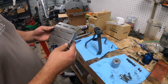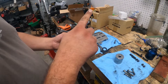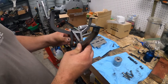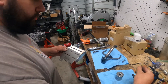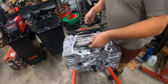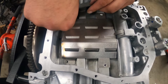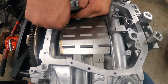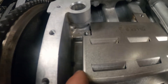If you're doing a stock rebuild this is going to look different. This is the Killer Bee baffle — it's pretty. This is their moneymaker, the pickup. We've already installed the O-ring and oiled it — make sure you oil it. This is the super heavy-duty pickup which will not break. The '06 and up one that comes with the pans is also pretty good, but if you have an older one you definitely want to replace it. Take the baffle and a couple of bolts and put them in hand tight.